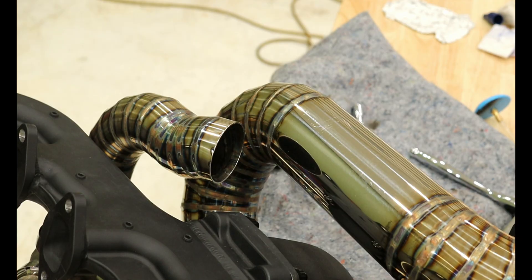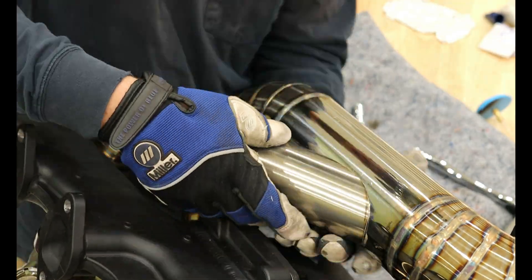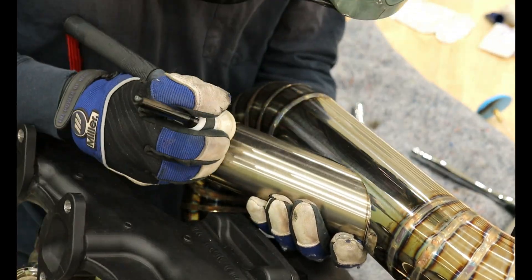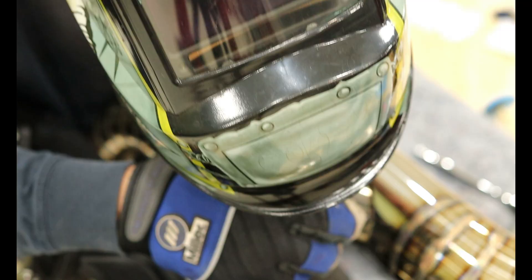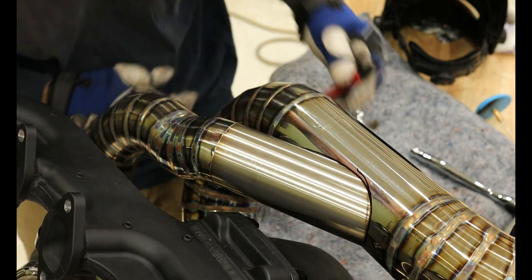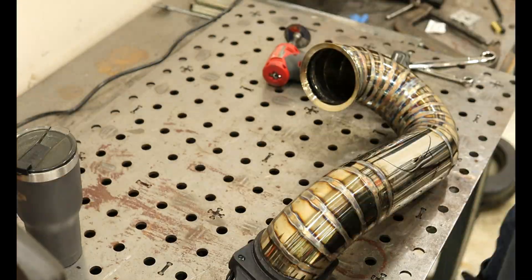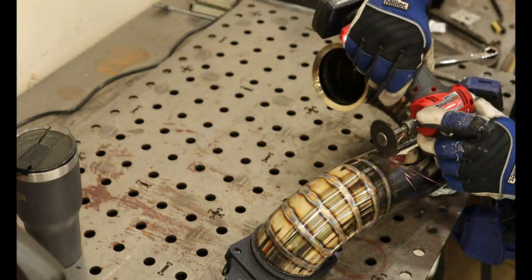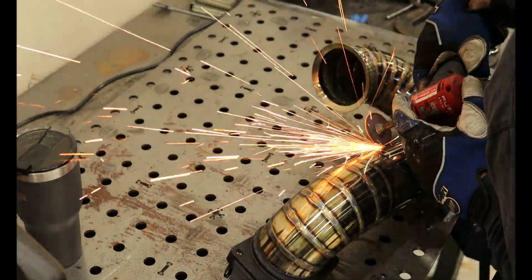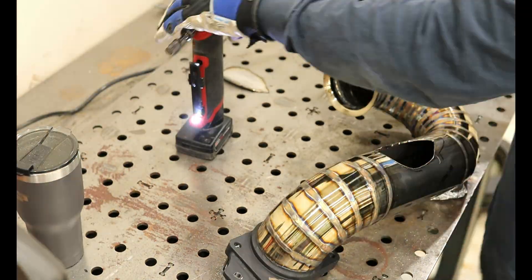And lastly, the scariest cut of them all — cutting the hot pipe. If I didn't get this perfect, I essentially just ruined it. I took lots of time here to make sure I cut it out properly by slowly creeping up on the cut line. I figured I would rather be shy of the cut line than ruin my hot pipe, so I'm sure I left a bit more than I should have. Lastly, I reinstalled everything, tacked it up, and began fully welding. I didn't film this because it was late at night and getting into that joint with everything connected was the hardest weld of my life.